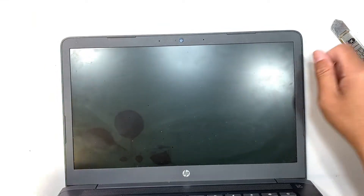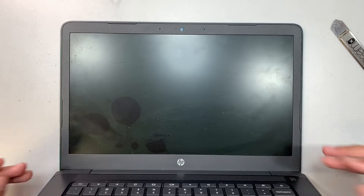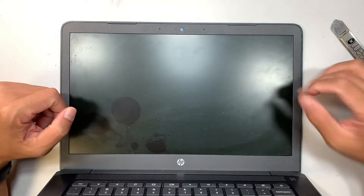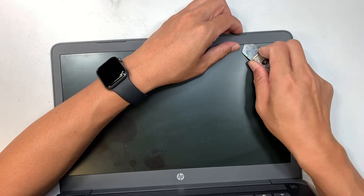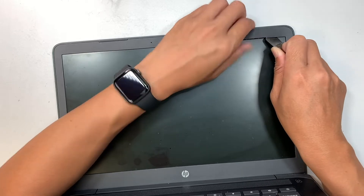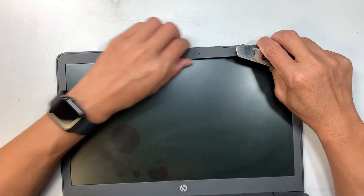As you can see, the LCD screen here has no screws or anything holding down the bezel. So in other words, it is double-sided adhesive — somewhat taped onto the bezel and also the clips. So we need to use the metal prying tool to stick it in between the bezel and try to pry it open. You're going to feel it's a little bit difficult because the bezel is double-sided with sticky tape on it.